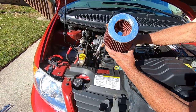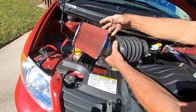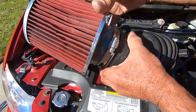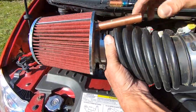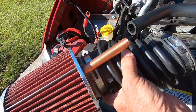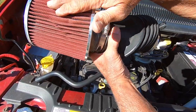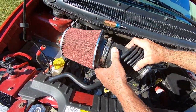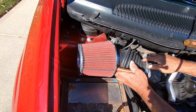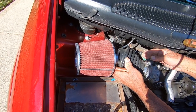This is the air filter we're using now — I think it's K&N, I'm not sure. It's pretty small. I've done some modifications: I'm using the original boot and I used some silicone to make sure things were sealed up. I actually put this tube which is accessing the motor's tube, and you can see it's got a little depression in it right there, so I'm forcing it right down in there. It's a squeeze, no doubt, but it worked.